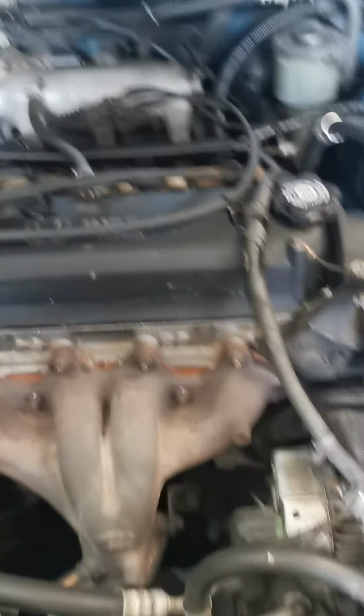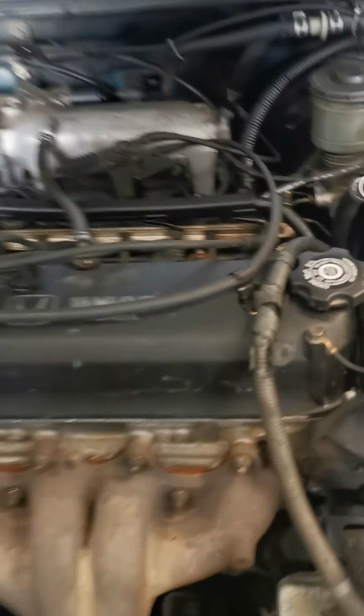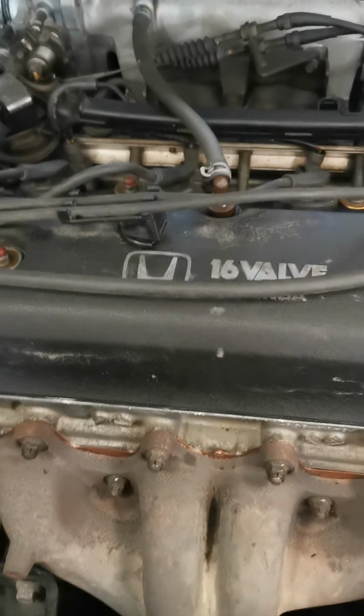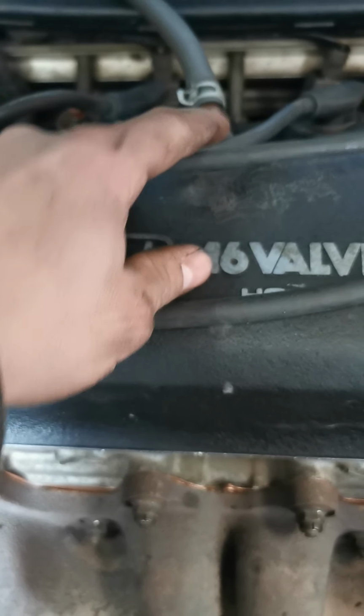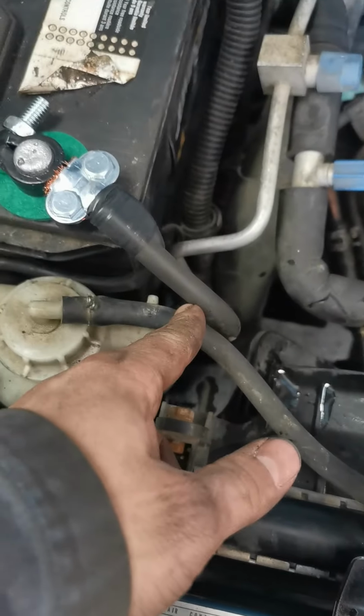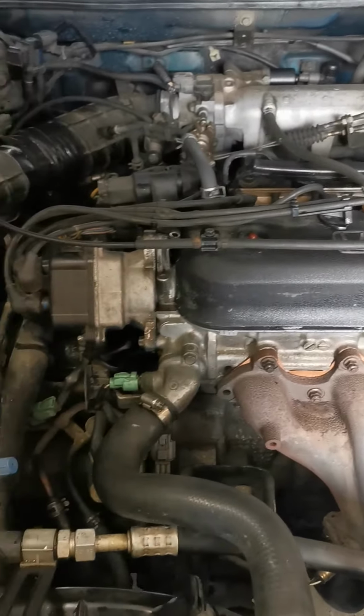What else did I get? The head gasket. You can see a little bit of the blue right down there. That was under $30 at Rock Auto. And I think that's all new. Oh no, I lied. One of the spark plugs got damaged, so a fella did the right thing and just bought one spark plug. And when I was taking off this PCV valve, I broke it, so I had to get one of those. And I changed out the oil filter. So one oil filter, one PCV valve, one spark plug, one alternator belt, one head gasket. Torched the valves straight. And I put some new clamps on. Made myself a new ground cable, and it goes to two different spots because I was having a no-start issue. Starts up fine. So, very cheap solutions for expensive problems.